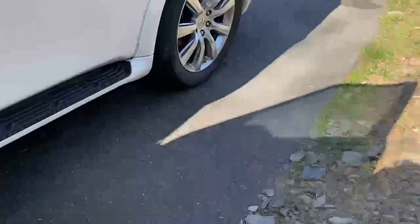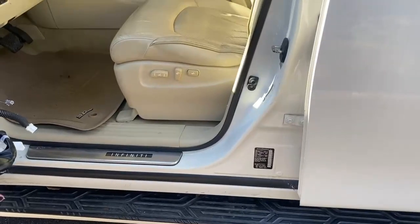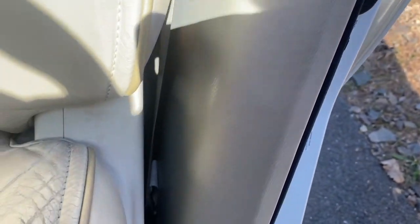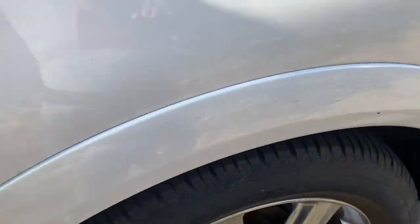One side of the vehicle actually carries two impact sensors. There's one right in the post between the front door and the back door. You gotta move this cover here, and it's right there — a 10mm socket will take it out.